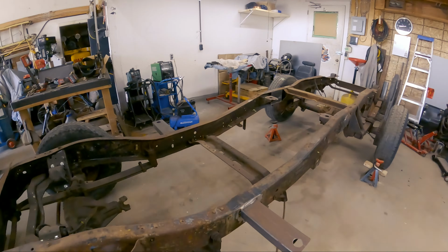So basically, Ron, what you've done is you've taken what's left of the old quarter, right? Replaced it with this piece, and then to get your shape, just followed along with what the remaining parts were. What's left, because the bumper on these Chargers, they come over and down, eh? So I'm going to have to make a piece that goes in here like this. Yep. Bring this piece down. Do like a 90 degree in there.